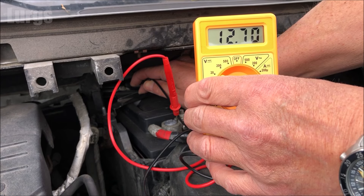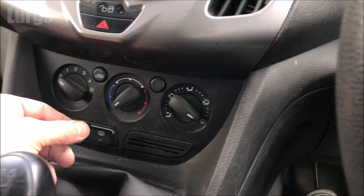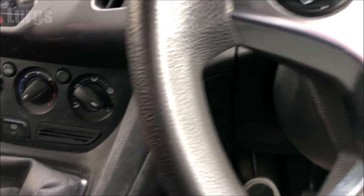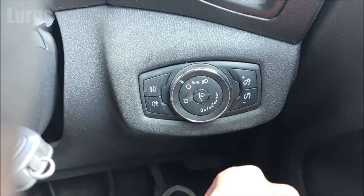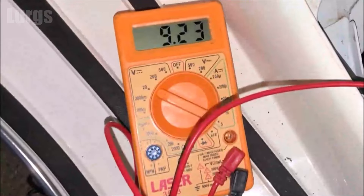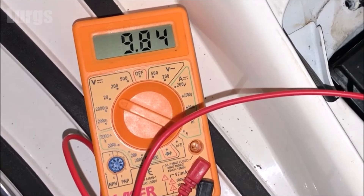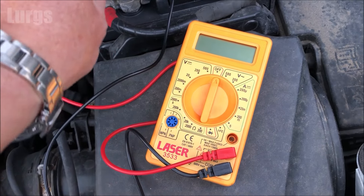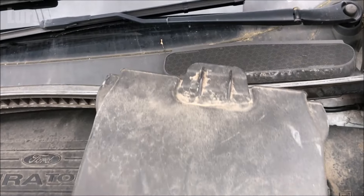You can also do a car battery load test. Without the engine running, put the ignition on and put as many gadgets on as you can: the fan blower on maximum, hazard lights, headlights, any demisters, plug something into the cigarette lighter. Then attempt to start it. If it really struggles and the voltage comes right down, that indicates a problem with your battery and it's time for replacement. But if it turns over fine and starts with all those gadgets running, then your battery is probably in good condition.